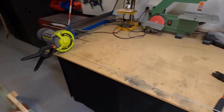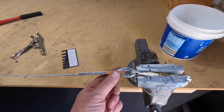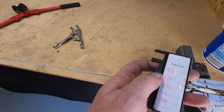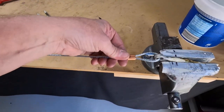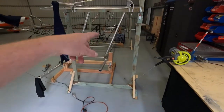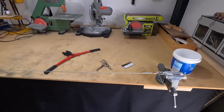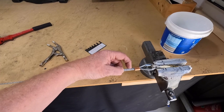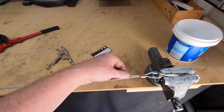I've got both ends done. I just clamp that gently to the grinder without turning the grinder on — extra pair of hands — it's in the vise. Slide up the crimp, crimp it, and then you've got a go no-go gauge for one-eighth of these Nicopress sleeves. Pretty important this — like if these cables fail, basically the wings come off. So this is how I'm doing it: crimp them down, pay attention, give yourself a good tag, and then the book says no more than 10mm protruding at the end, so we'll just zip that off.